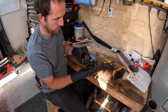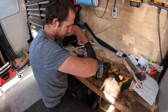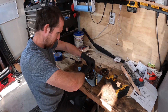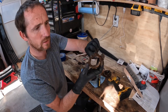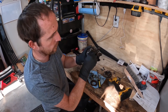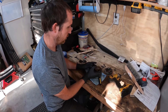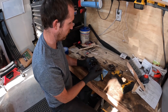Before I clean this up, there's a little gear that slides in and out here — that's the piece that engages. It's all stuck, so I took a screwdriver and stuck it underneath this little lip right here and slowly worked my way around until it comes out. That right there is what was stuck. You can see the teeth on the inside; when you engage the hub, they slide in to engage on those teeth. This one was stuck and wouldn't slide in and out — that's why the hub wasn't working.